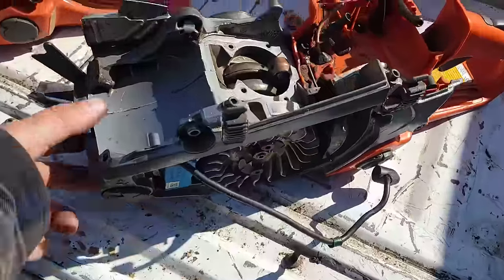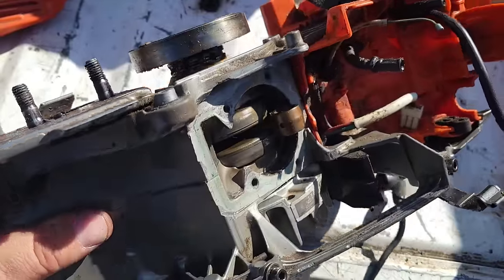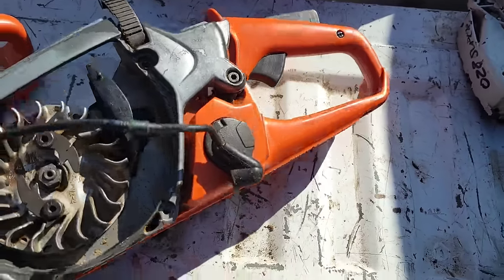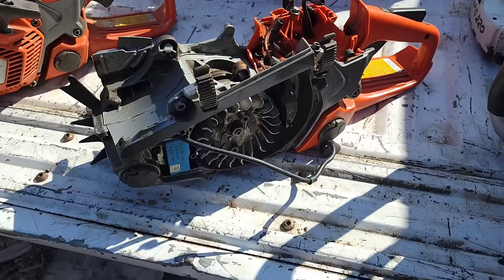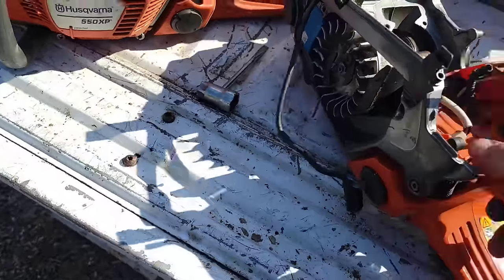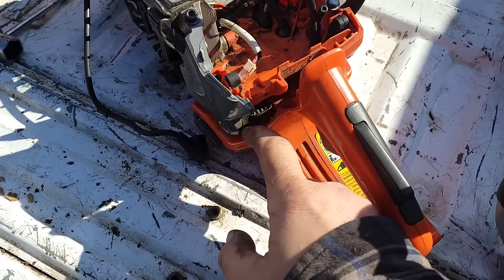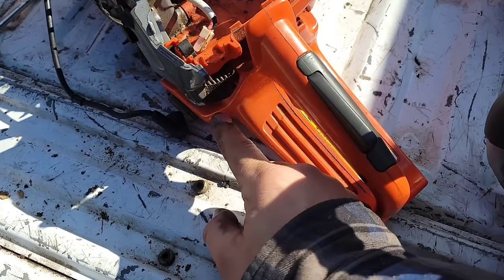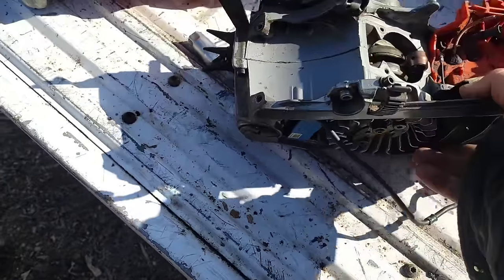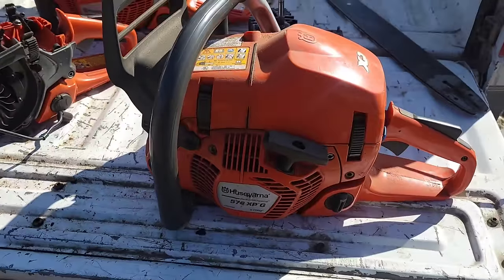All the damage to this saw that you see, the discoloration in the case, the oiler gear that got cooked years ago that I had to replace, the broken AV mount that I had to replace, everything that I've done to this saw is because somebody had a dull chain. And what happens when you have a dull chain? You reef on the saw and you flex and you push and you end up breaking AV mounts. See these limiter straps? They will let it move so far and then they break. Okay? Broken AV mounts are often a sign of dull chains. This saw here, absolutely smoked.